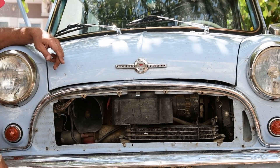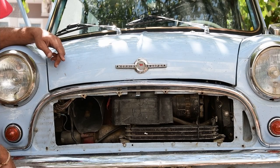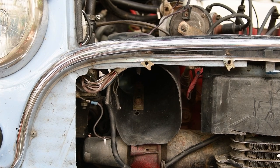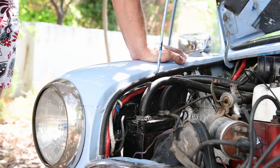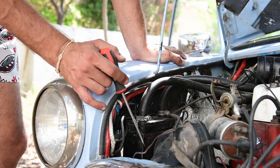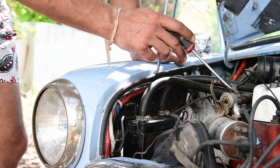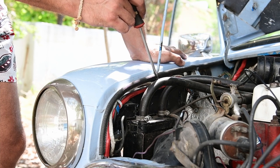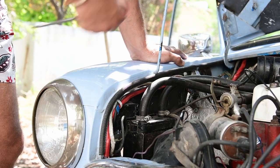The solution to increasing the cooling capacity of the standard Mini cooling system came in the form of the fresh air scoop. Since it already draws in huge amounts of fresh air, I figured why not use it and come up with a design that will help my Mini cool down. By chopping up the back of it and fixing it onto the engine, I came up with a pretty interesting cooling installation involving a backup radiator — basically a side-mounted auxiliary radiator. One side connects to the on-off switch for the heater and the other side goes straight to the pump return feed.